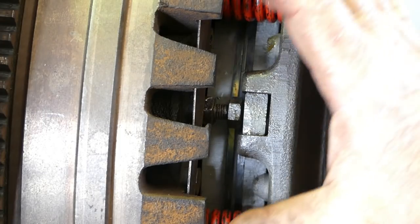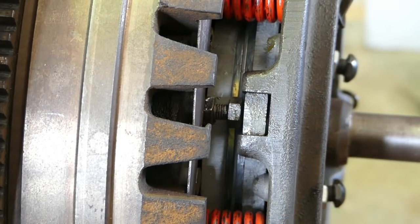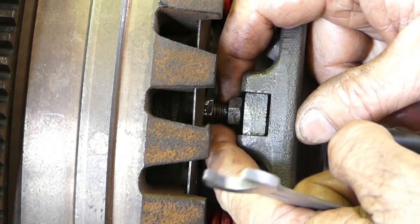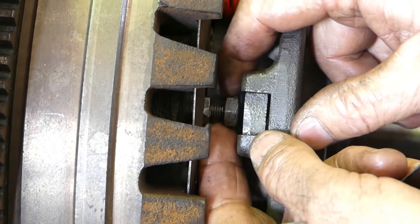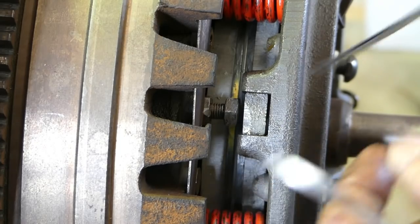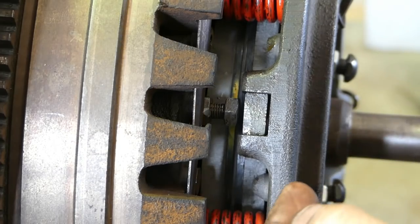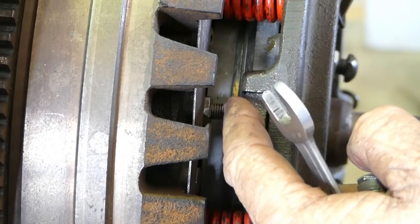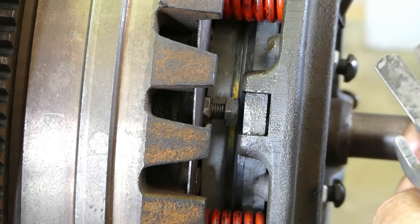You can adjust this from underneath. You can see under the tractor, and when you pull the plate off the bell housing at the bottom, you can get to this, no worries, and it's an adjustment that you can do at any stage. So if your PTO clutch is not releasing, sometimes this gap's too big, and if your pedal's out of adjustment, it releases the main clutch, but then you don't actually get to push the PTO apart. So look, I like to set it at about 65.